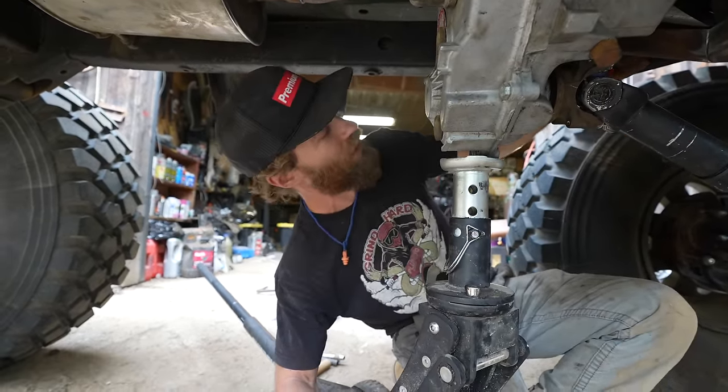That sounds crunchy. You get a stick in the fan? I don't know what that is. Is anything coming out the bottom? I don't see anything other than that fluid that we knew was leaking. It feels like it's right underneath me. I mean, everything's fine. Just the transmission cooler fan is messed up. Oh, shoot. Wasn't it brand new? Yeah, but the transmission mount is so floppy that the transmission bounced around and smashed the trans cooler fans.